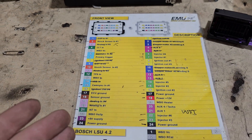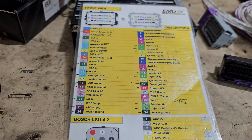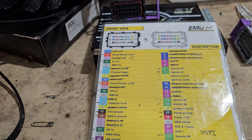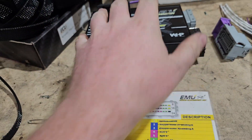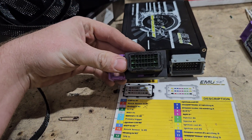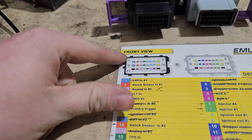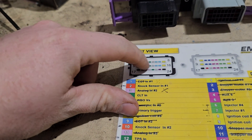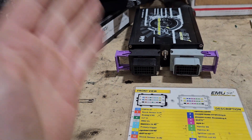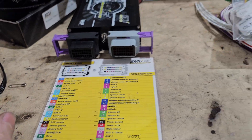This is going to be a rather quick video but I want to make it straightforward. We're starting on the black connector. You're going to be looking at this like you're looking at the front of the ECU — you've got the vacuum port for the map sensor and you're looking at the back of the connector. Pin one is all the way on the top left. The pins are numbered: one through eight, nine through sixteen, and seventeen through twenty-four.